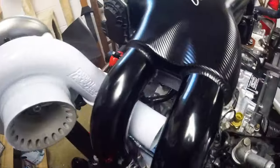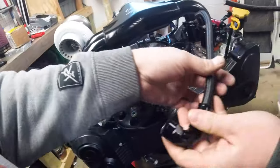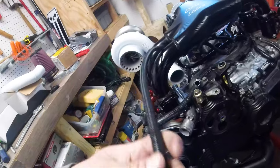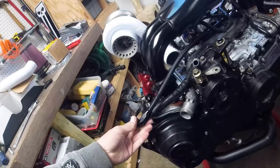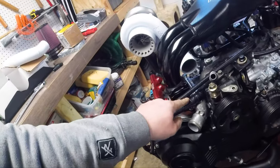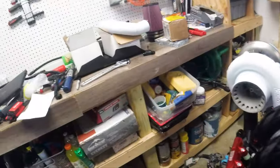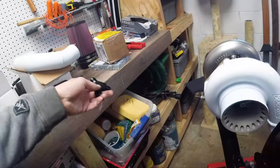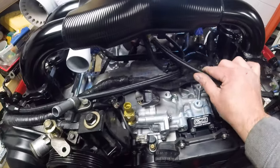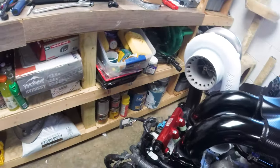We've mocked up this T approximately where it's going to go under there. We cut some fittings and put the ends on them — the PTFE stuff is tougher to work with but it's going okay. These lines are not very flexible but they snake up under here. The T will go under there, and then we'll start doing the return side, leaving lines a bit extra long.